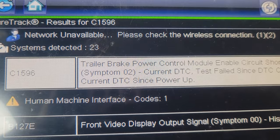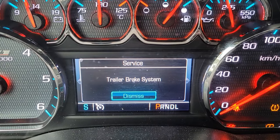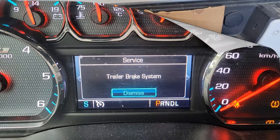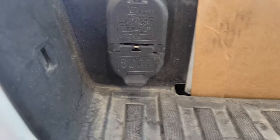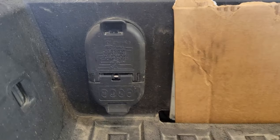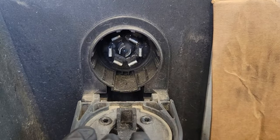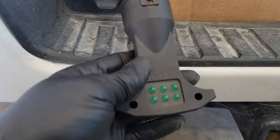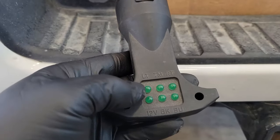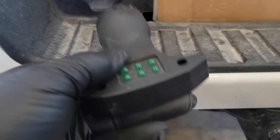In this video I'm going to show you what to do and what to look for to get rid of this warning on your dash and hopefully save yourself a trip to the dealer. First thing I usually do when dealing with trailer lights or any trailer power is go check your connector — take a look inside, make sure everything's clean, no corrosion. I carry something like this, it's a quick little tester with LEDs that light up with each circuit you turn on. I'll leave a link to one like this in the description.